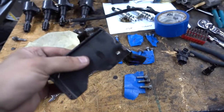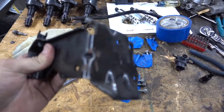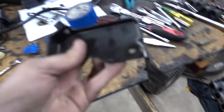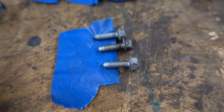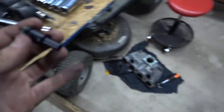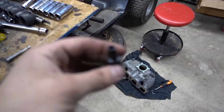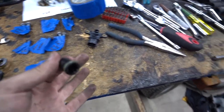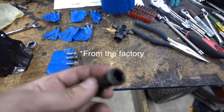Just a quick side note — the only thing I did that the guide didn't say to do was to take the high pressure fuel pump bracket off solely because it makes removing the intake manifold itself so much easier. It's just another two bolts to remove it, so why not? Also, this is my PCV valve — I pulled it from the intake manifold and blew and sucked on it and it works. So my PCV valve was not clogged and all this still happened. It's flawed by nature — that's just what it is.